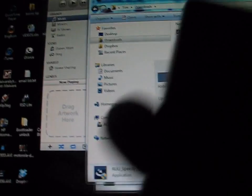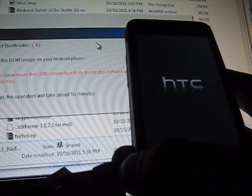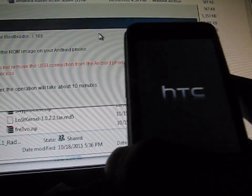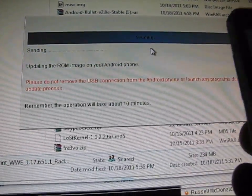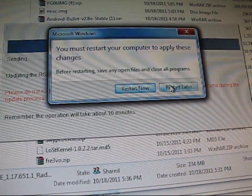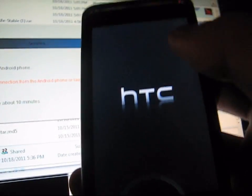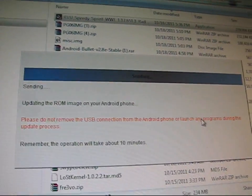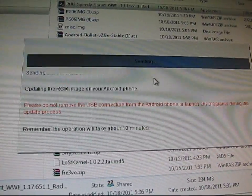It's going to reboot your phone and start a progress bar. If you get an error when running the RUU, just exit and run it again without unplugging your phone. If you get another error, unplug your phone, reboot it, and try again. If errors persist, install HTC Sync and try once more. Don't let your PC turn off during this process — it could take up to 10 to 15 minutes. Dots moving on screen means it's working, and it says 'Updating signature'.